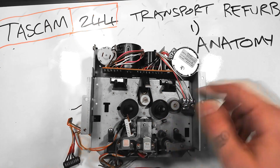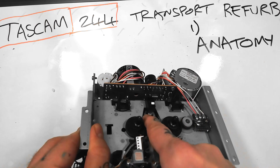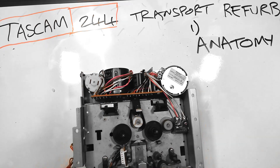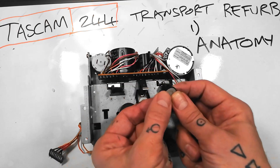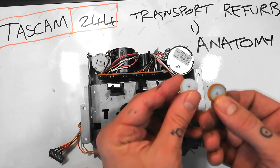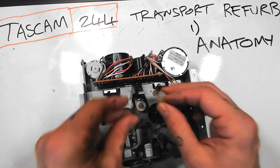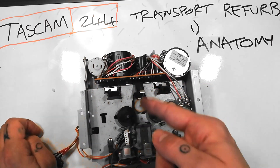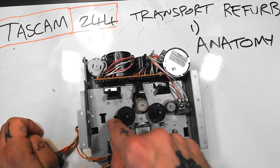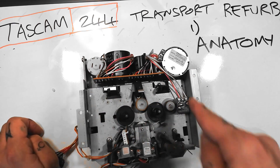The next motor is the idler motor. That motor is turning a little brass spindle — I'll call it a spindle, though that might not be the right word. And then there are two little wheels — these are the idler wheels and they have idler tires on them; this is the black rubber tire. Here's ones where the rubber is decayed. They're separated by a little spring — a bottom one and a top one separated by a spring. That brass spindle is turning the lower one, then the upper one is turning either this reel hub or that one. Depending on the mode, it's going to make this one turn so the tape goes this way, or it'll switch over and make the other one turn, making the tape go that way.